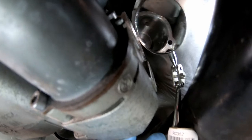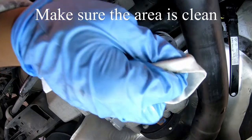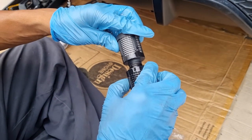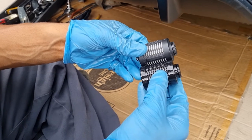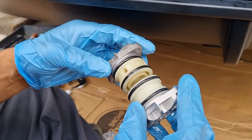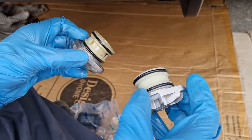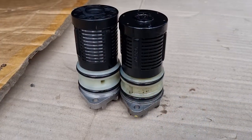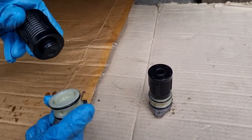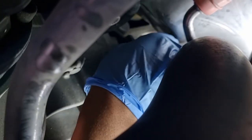Using a mirror, you can inspect the housing to make sure there's no dirt inside. Compare your old and new filter — it looks the same and the dimensions are the same. Now we'll go ahead and bolt everything in. The bolts on these filters are normally between five to six Newton meters — just check your particular vehicle's specification. When reinstalling, make sure you lube up the new O-rings — there are two here and one here, which I've already lubed up — then just slot that in and tighten it.